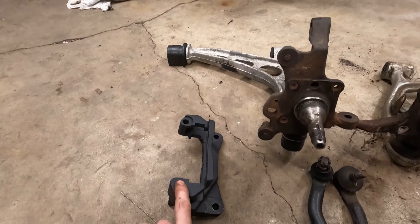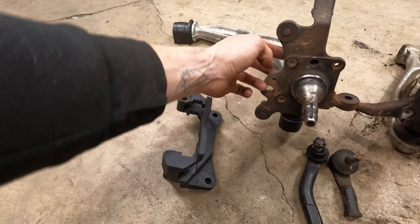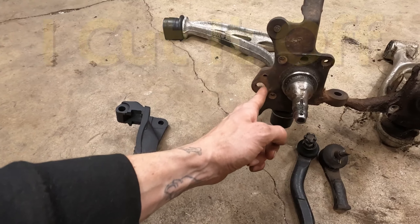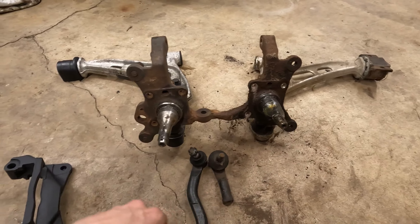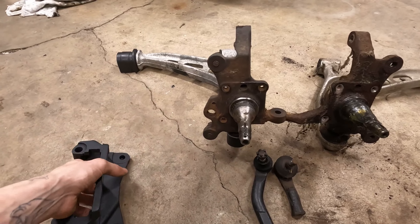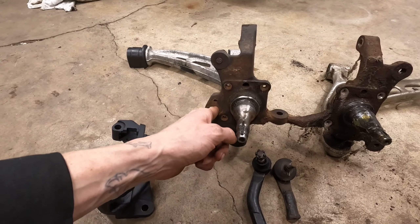So I actually reached out to Riggs to see if he has a set of ABS caliper brackets, because I'm sure they'll be notched or stepped back. Whereas these ones kick out right where the ABS bracket is. If not, I'll probably just cut it off. Looking at the size of this knuckle, I can almost see the cast lines of where that piece would have been cut out. I'd essentially be cutting center through these holes and winging it right off. That being said, I can still install this front knuckle — those are modifications I can easily make on the car by just turning it out and taking the rotor off. But yeah, just my luck — keeps snowballing.